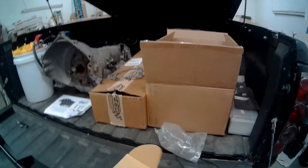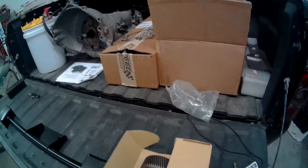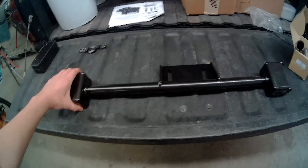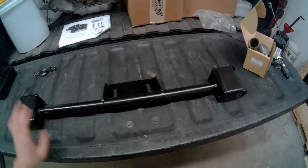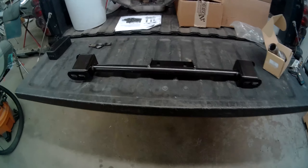Mine is 4WD, so I'll need — this is the input shaft on the transfer case — it's a different spline on the 4L80E, so I'll have to transfer that into the transfer case. A new crossmember — I think this is by Speed Engineering — it's for a 4WD, they also make it for a 2WD, and it was $168 I believe.